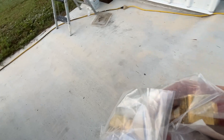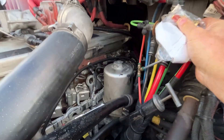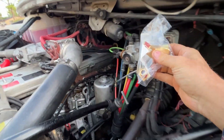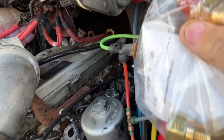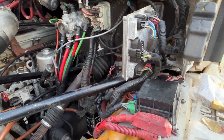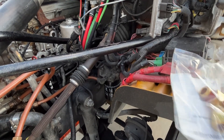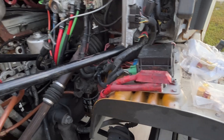Let me make sure I bought all the right ones. They're 3/8 pipe thread. I've got two of them for the 5/8 diameter tube, one for half-inch — that's a 90. The first two are 45-degree fittings, and then there are three that are 90s to go to 3/8. That'll take care of all of those.